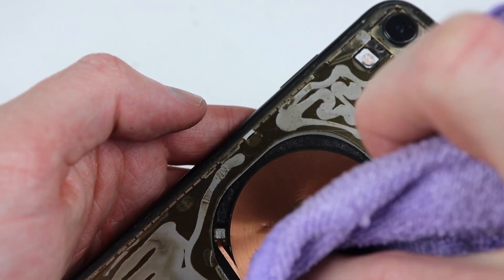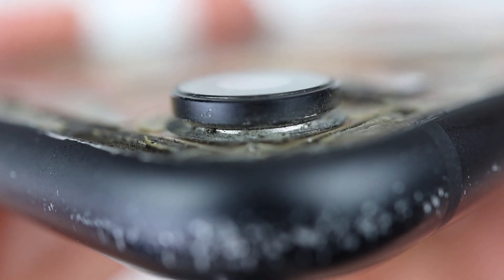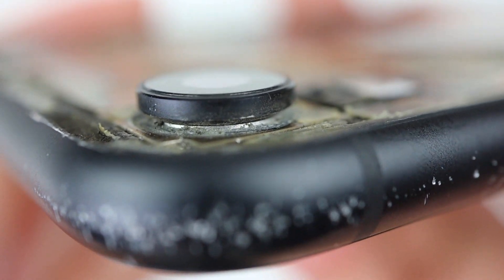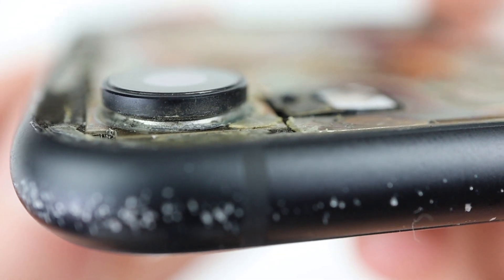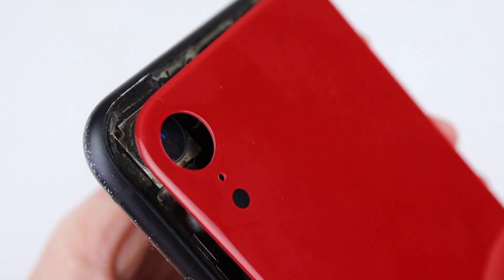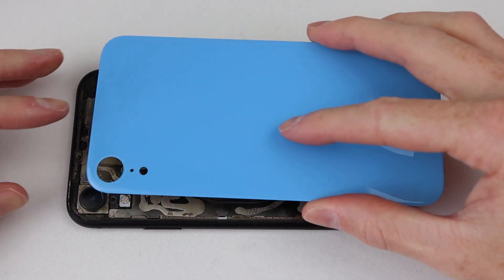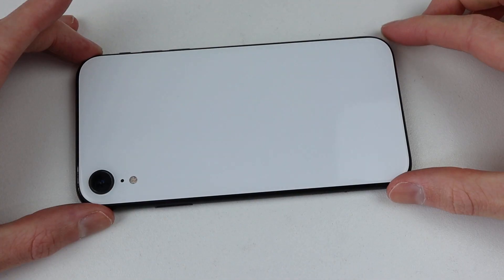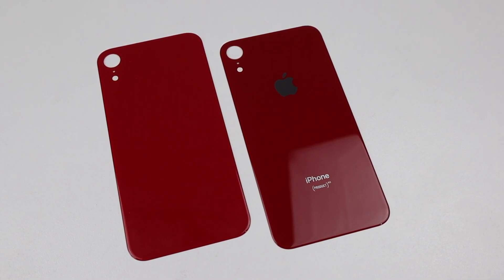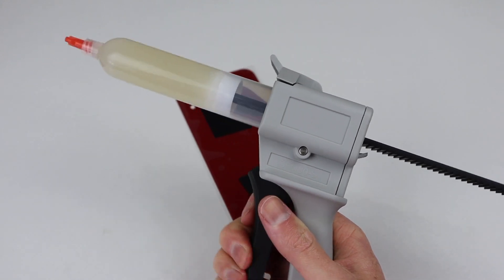After cleaning up the wireless charging coil, it's now time to install the new rear panel. You can see there is a slight ridge underneath the camera which the old glass would have sat underneath — our new glass doesn't require this and will just go straight over the top. Unfortunately, I lost the black rear panel that Rira sent me, but I have every other colour for the iPhone XR, so I now had to make the decision on what colour I wanted. Due to copyright, Rira doesn't supply glass with logos, however I picked up one that did, so I'll be installing that one instead.